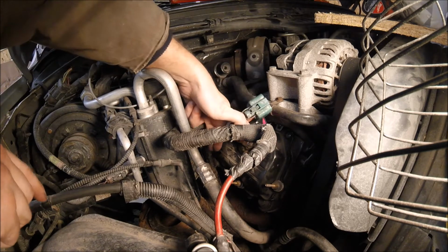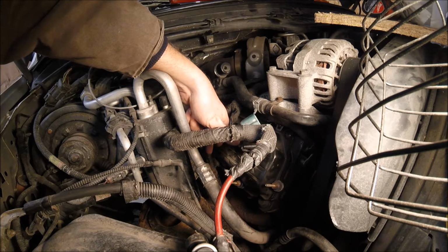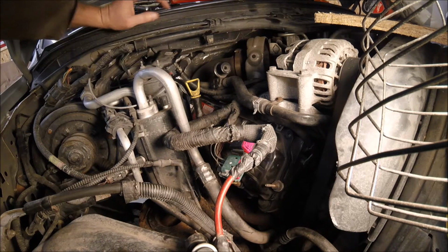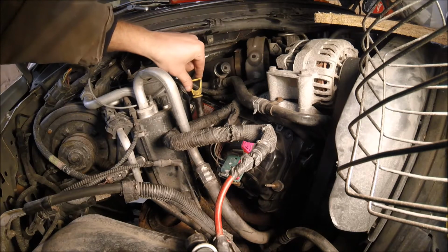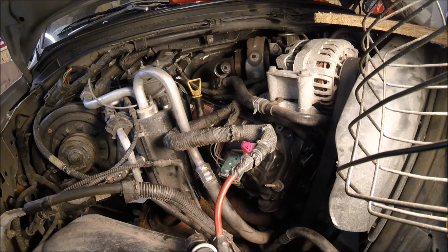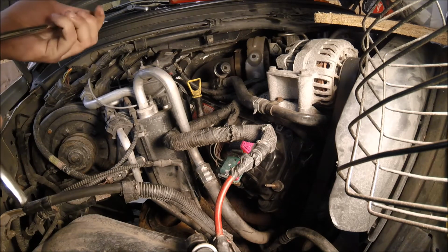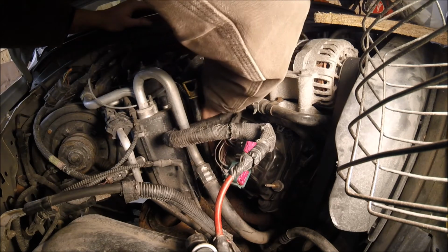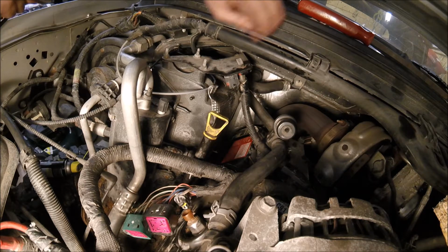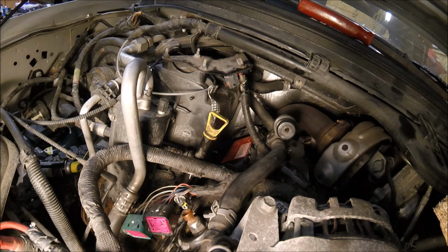Alright, so right down here, your transmission dipstick tube goes on the top of that stud right there, which would be number 9. That's your last studded one on the bottom, and it's all regular bolts. But put that tube on there, and then I'm going to put this nut on there, and it goes on top and holds it in place. It's 10 millimeter. Alright, so I tightened down the nut on top of the hydraulic dipstick tube, 10 millimeter.